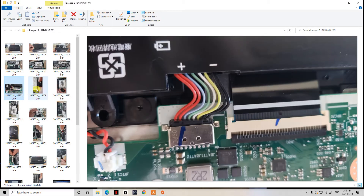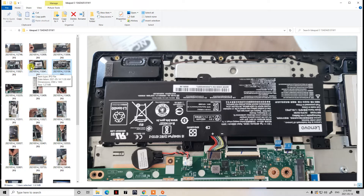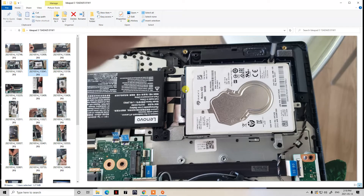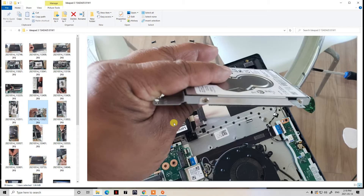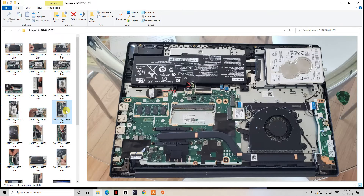Once you remove the battery connector, go back and unplug the hard drive. Grab it from the top corners with your index finger and thumb, and just wiggle it out — that's all you need to do. On the bracket holding the two-and-a-half-inch drive, you'll see one screw here and one screw there, with two more on the other side. Remove all four bracket screws.